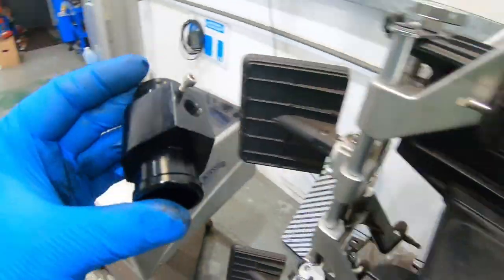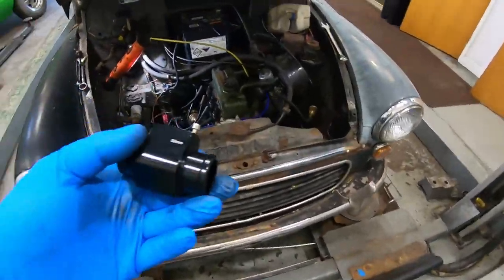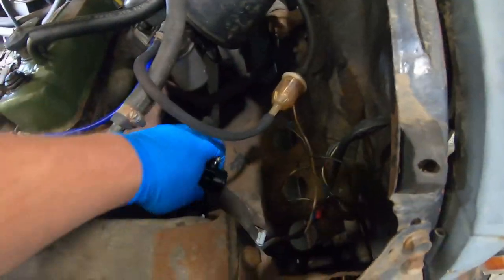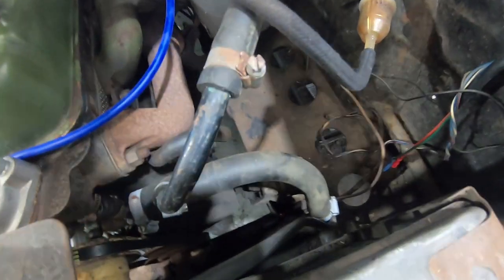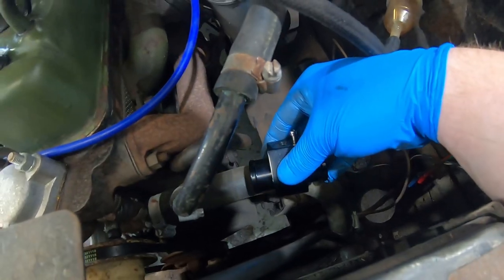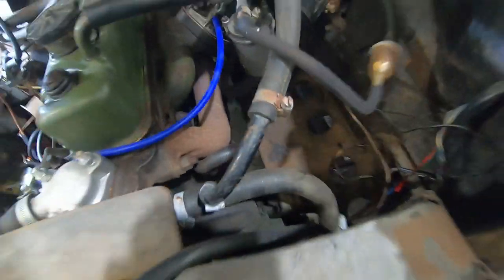So that's that fitted. Next on my list, the only other sensor I've got to fit is the temperature sensor. Now like I said earlier, I have got one of these on the midget. I will admit I guessed the size - 32 mil. The outside diameter of that pipe is 34 or 35, I think I worked out. And it does look like it'll fit; I should be able to stretch over that. So I need to cut through that hose. I'm just going to make a mess on the floor, so I shall grab a drip tray and come back after I've done the cutting, just in case it doesn't work out.